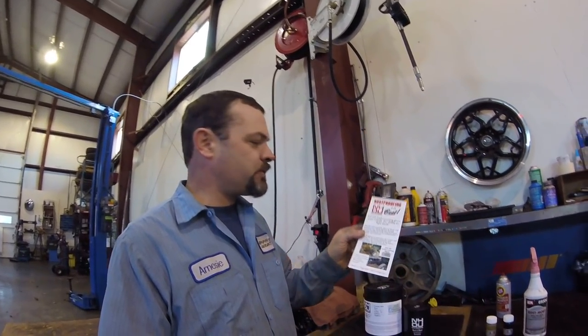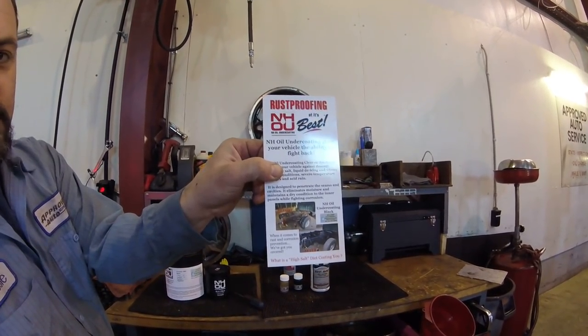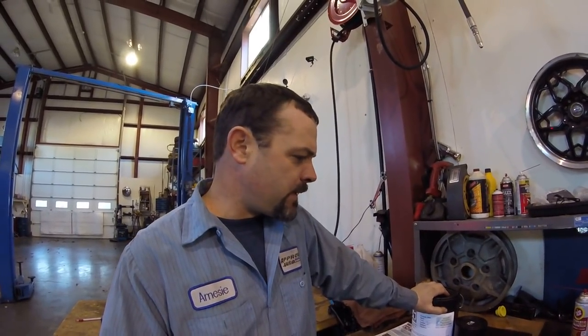One thing that I recently had dropped off — someone wants me to try out their New Hampshire oil undercoating. One thing we do is we undercoat vehicles. One type is kind of like the spray-on factory black undercoating — I've got a little can of it here. But another thing we use up here which seems to work better than a lot of these hard undercoats is an oil-based undercoating. Back in the day, people used to use boiled linseed oil to protect the untreated metal portions, frames on a pickup truck or cross members and whatnot.